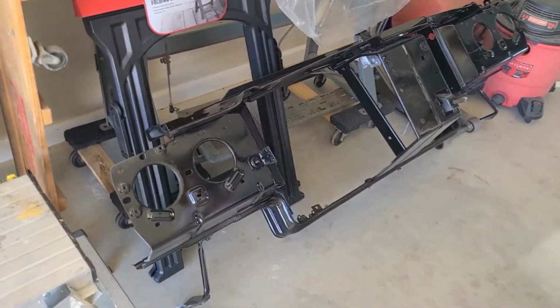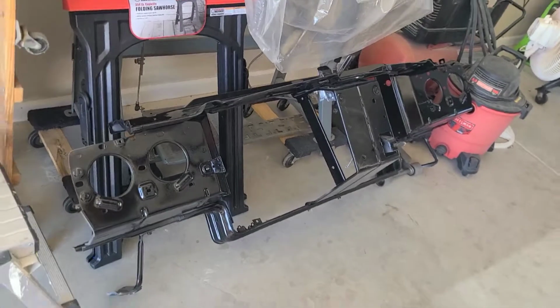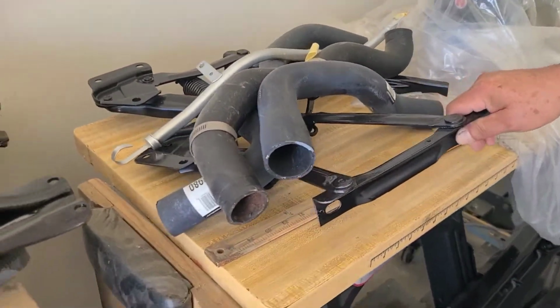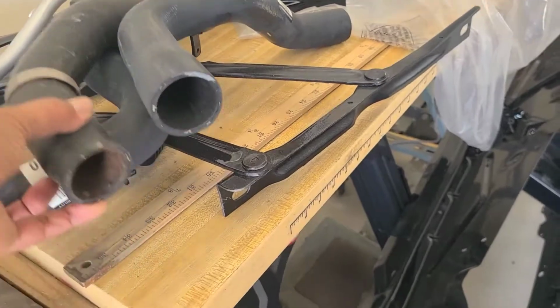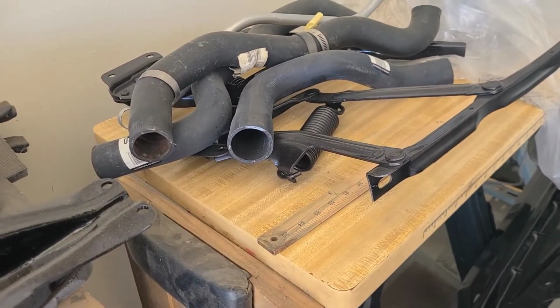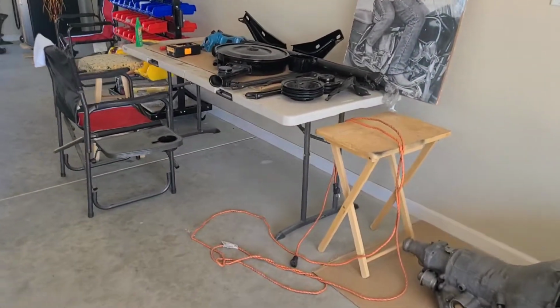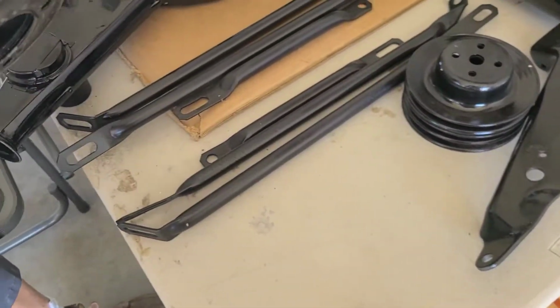But as I got into restoring the car, there was surface rust, which is common on 70s cars. There was just so much cleaning. Your hinges had surface rust, and I had to grind them, wire wheel them, and hit them with the buffing wire wheel. Then I got single stage chassis black acrylic enamel paint, and it gave somewhat of a powder coated appearance, but it's better than rattle can. We got these over here also that were painted with acrylic. These were not powder coated, but it's a nice, durable finish.